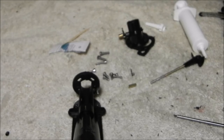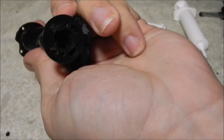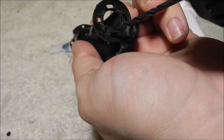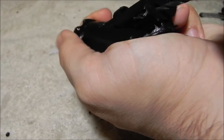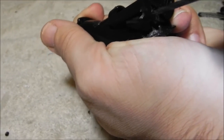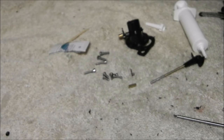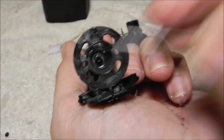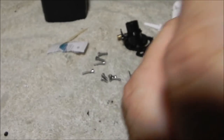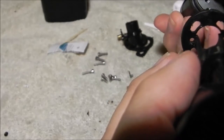By the way, this could easily be done with Dremel tools, but I usually find this a little easier. I'm going to be putting my motor screws in this hole and that hole, so I'll take this and run it up to take a little bit of material out right in that center portion. I'll put the motor in here and here, and what we're looking for is our 19 millimeters.